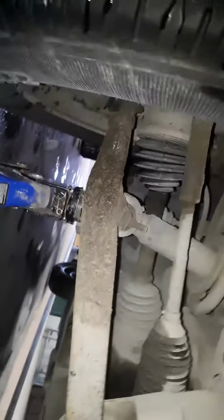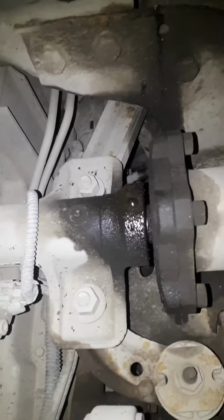Okay, coming in on the front right tire, about 40% tread on them. Okay, your outer CV boot intact, your inner CV boot intact. A little bit of seepage on that, that's pretty common, not too bad. Your shock is good and dry,